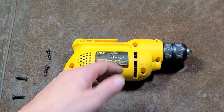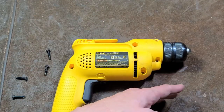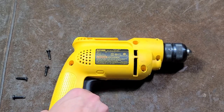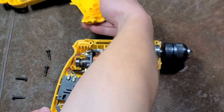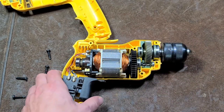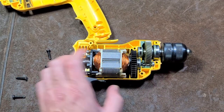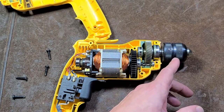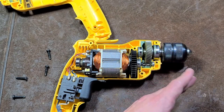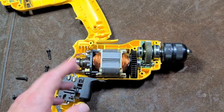Even though they don't use a lock screw on the chuck, there's a caveat — on many drills removing the chuck is a big issue because pounding on the allen wrench can destroy gearboxes. But it's actually okay on a split-case drill, because when you pull the case apart you can pull off the gear, clamp it in a vise by the gear itself, put in the allen wrench, and get all the torque you need. For a long time in the 80s these had three-eighths spindles, but sometime between the late 90s and 2000s they started going with half-inch spindles because the smaller ones were getting bent too easily.